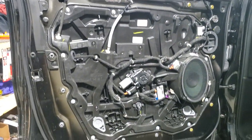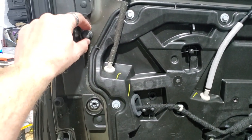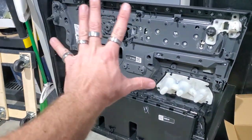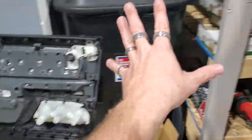There's the back side right here. On the passenger side, I made the mistake of leaving a bunch of these clips in the door instead of the panel. See how they're open here — they got stuck and ended up missing from the door panel. You want to make sure you take them out of here and put them back into the door panel, otherwise you're going to have problems with it connecting.